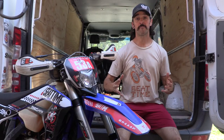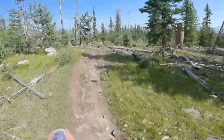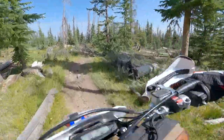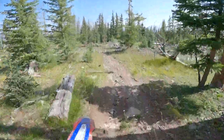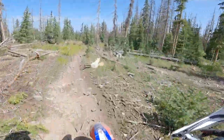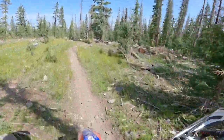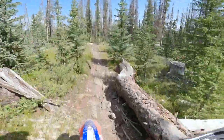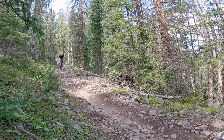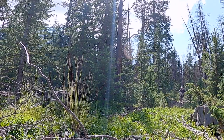Now that I'm back from Colorado, I've got a few lessons learned. One: I should have gone one tooth bigger in the rear sprocket - I had a 50 and definitely should have gone to a 51. Also, at the Tomichi Creek Trading Post I should have taken more time to dial in the bike because it was still way too stiff and I was pinballing all over the place throughout the weekend. The carburetor was also really not running that great.